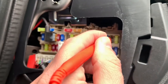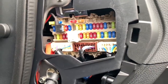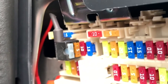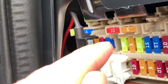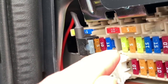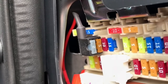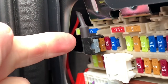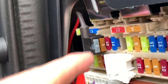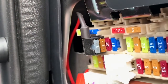There you go — as well, it is the lower part that gets 12 volts. So why is the position important? The power comes in from the lower part, goes through one fuse, and back to the circuit. Or it goes in and goes to the second added circuit. If you put the added piggyback circuit in the wrong way, the power will always go through both fuses, and if something goes wrong you will blow both fuses as well.